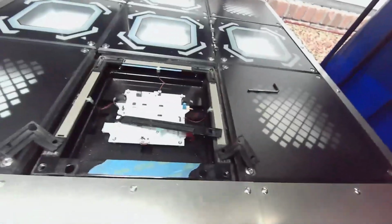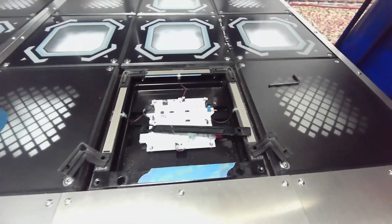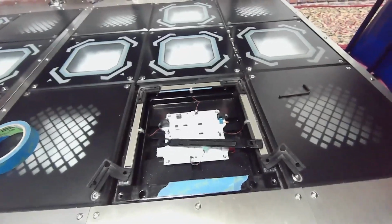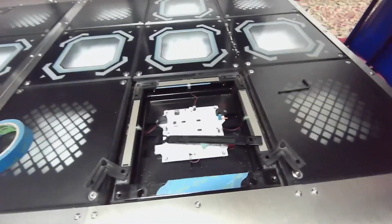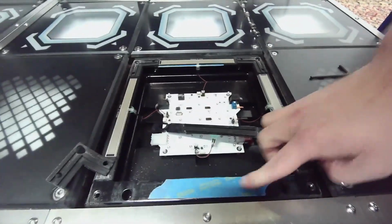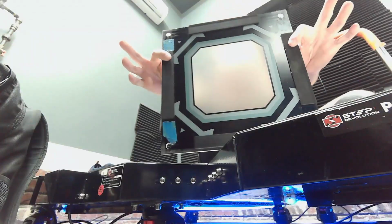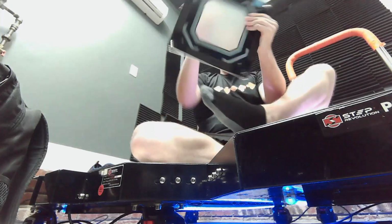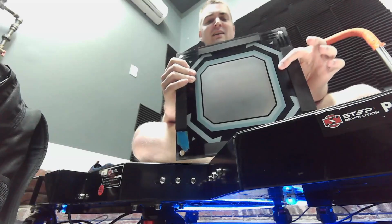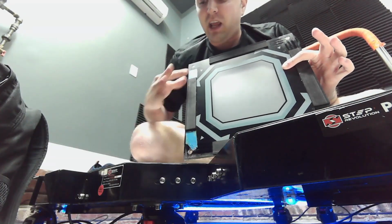So I would just use one or two pieces of painter's tape like you can see in the video, put them under the sensor, replace the corner grommets, place the panel on the sensor and actually press it with your finger and just see if it feels better before you screw in all the screws. When you screw in the screws, sometimes sensitivity can change, so do go ahead, screw in the screws. Use your foot to test, use your finger to test, and see if the sensitivity is better now. You want to have, again, uniform sensitivity, so you can do the big toe test where you put your toe in the middle of the panel and see if all of your sensors have uniform pressure when you press right in the center.